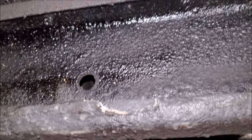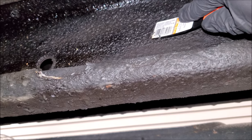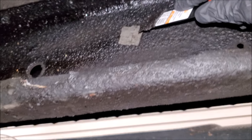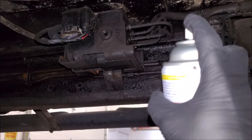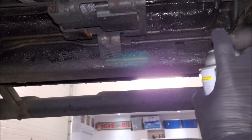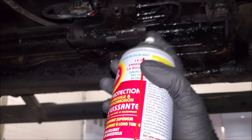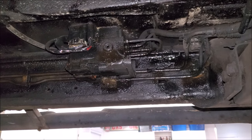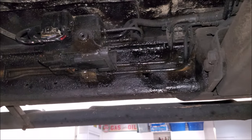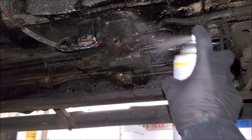Let's verify inside the frame as well — you can see there's a healthy thickness in here, and where it's a little shiny, that's the residue from the rust inhibitor, the fluid film we're spraying in there. Let's scrape this — the wax part comes right off and it's clean underneath. Key areas like here — this is all original in the truck, 2005 — you're really looking for areas where things can build up. This stuff is safe for plastic, so I don't care if it gets on connectors. The problem with ABS modules is they get covered in a lot of stuff and have tons of issues — it's a very expensive fix, and downtime can cost you a lot if you use your truck for work. So we don't want any of that; it takes just a few minutes.